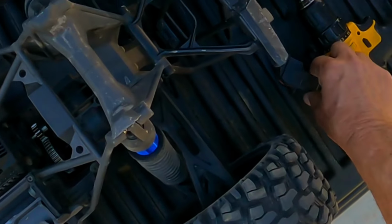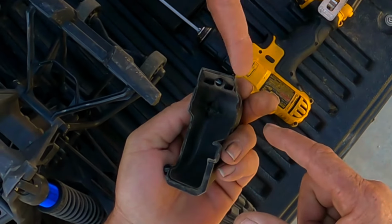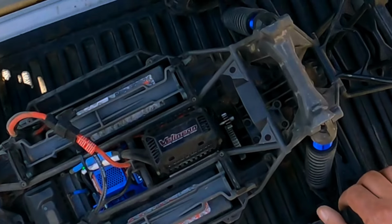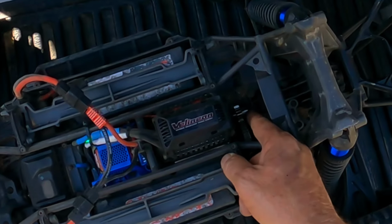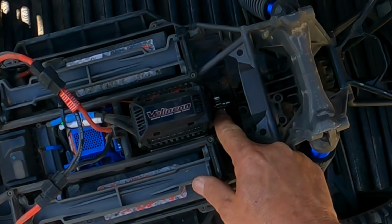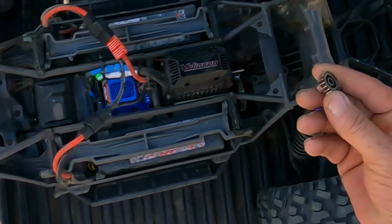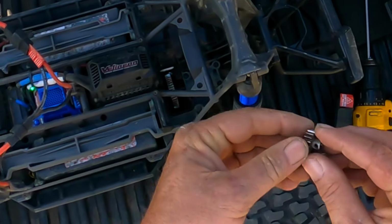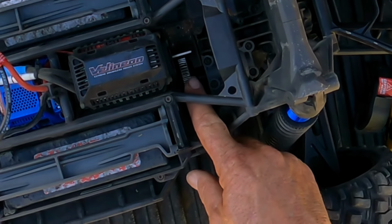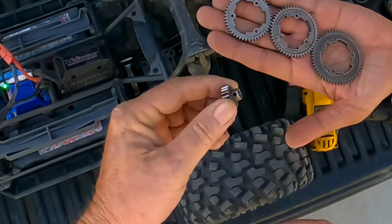Oh yeah. Because the cover doesn't have the bearing on it, you see? Can I buy an XRT cover and put it in? Possibly. Here you go. Yep. Thank you, Traxxas. But you have to use red Loctite. Oh, your grub screw is gone. No worries. I have a whole bag of that stuff. I actually bought a whole box from Amazon. Yeah, that's with these Robinson Racing gears. They'll do this. Look at the whole edge of it. It chewed it up because it had been sliding forward for a while. Yeah, as long as it lasts the whole day.